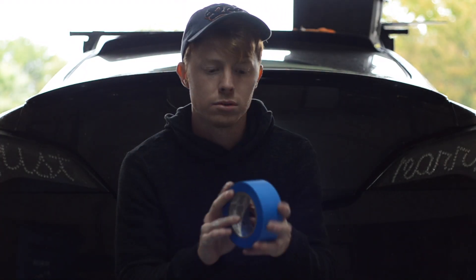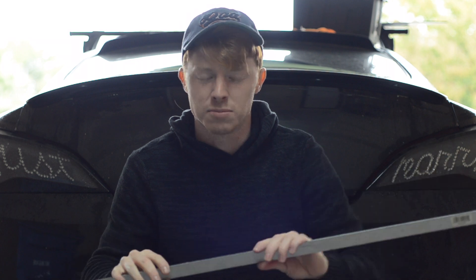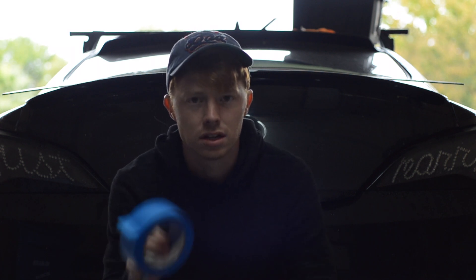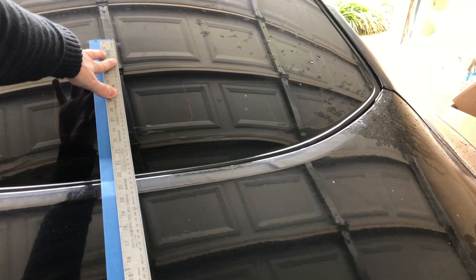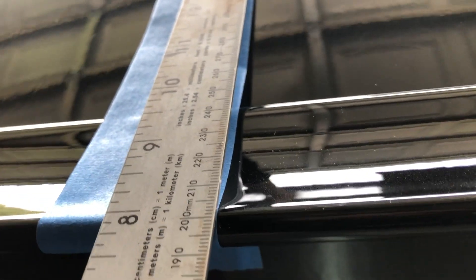If you can line it up with the center defrost line, you will have a centered wing. There are two ways to do that: you can use some tape, or you can use a straight edge — I personally like the straight edge. One of the first things I like to do is tape off the entire back of the OEM lip where you're going to be doing all the holes so you don't scratch or chip the paint. If you only have tape, you put the defrost line on one side of the tape line and hold it really straight, and that side should be perfectly centered. With a straight edge, you just line it up next to the defrost line and down here is where it should be centered.